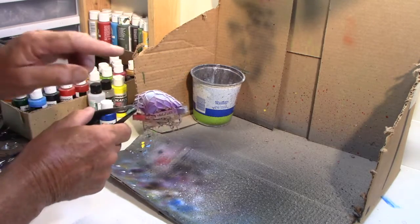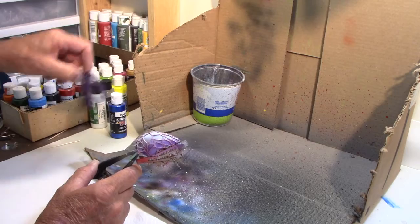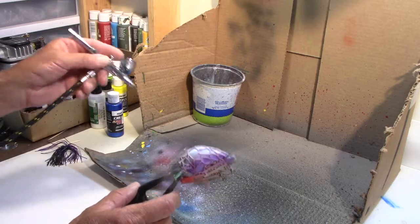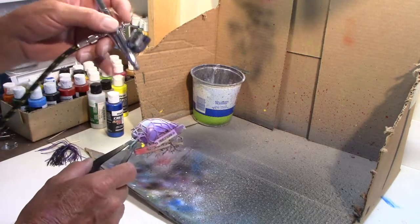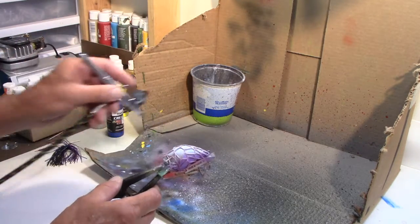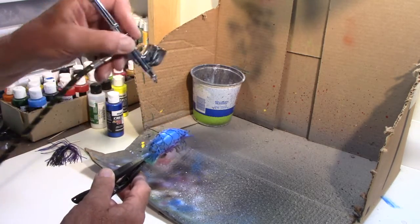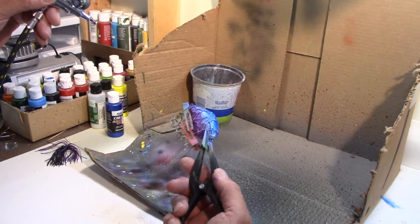All right, we have our plum at the bottom. Now we're ready to go with a pearlized blue on top. This blue might be a little lighter colored than what you see up in the skirt, but the black is going to show up underneath it. So I don't want to make this blue too dark or we'll lose it — we're going to go with a little bit lighter blue. Hey, we're making our own thing, it doesn't have to be perfect. Now from here I'm going to go front to back, but I'm going to kind of come from the side and go down so that way it lightens up as we go along the side and the colors blend a little better. Once I get to where I'm going to bleed down the side, I want to keep that gun pointed down so I get a little better blending of the colors.